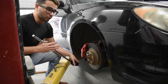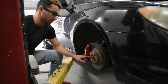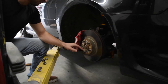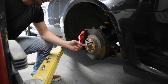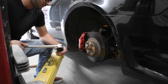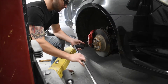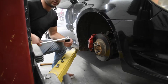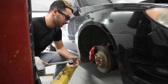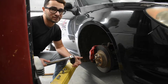Your first step is getting the wheel off, then your second step is getting the 32mm axle nut off. We tried to get it off with a hammer and chisel at first and it didn't really work, so we just used the 32mm socket and a sizable pry bar and it came right off. You'll want a second person to depress the brake while you're doing it, otherwise your rotor is just going to keep slipping.